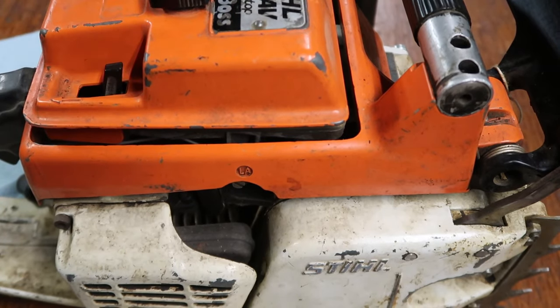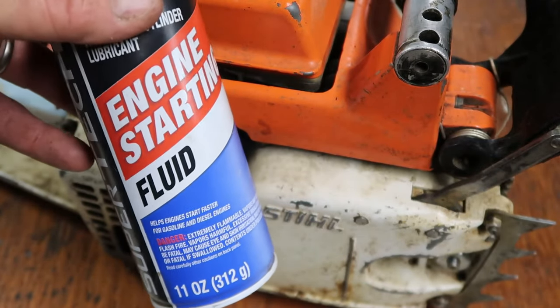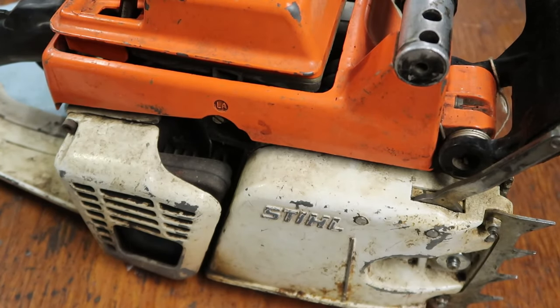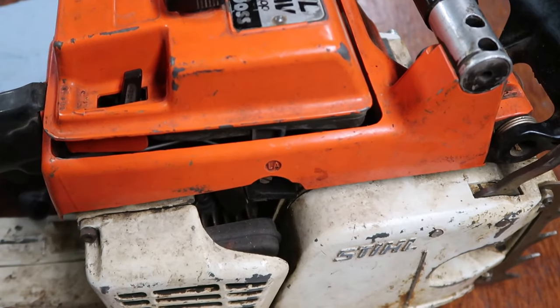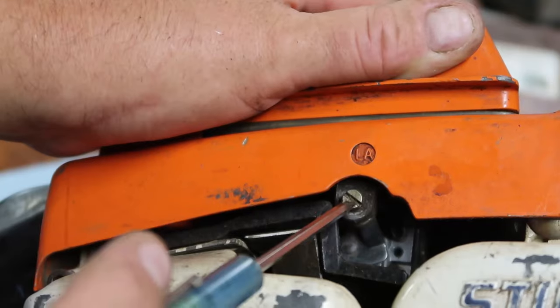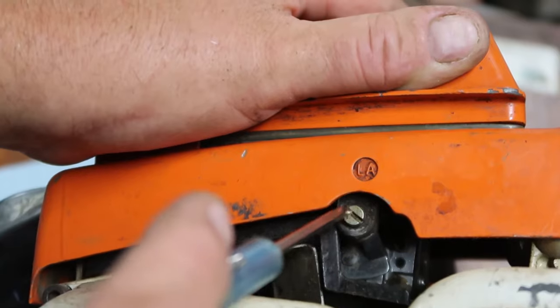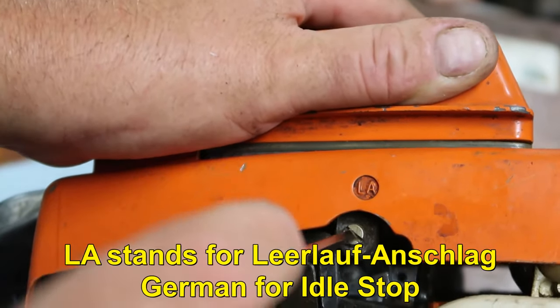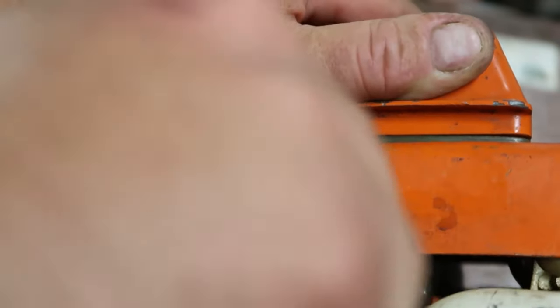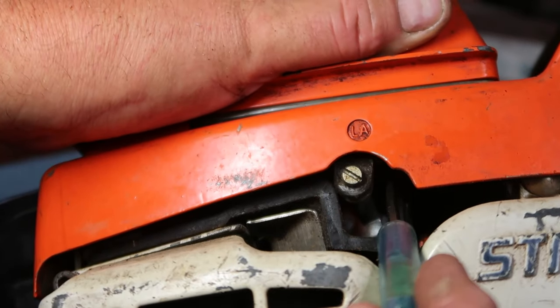Outside, I'll give it a few pulls to see if it starts. If not, I'll use this engine starting fluid — again, auto parts store or Walmart, a couple of bucks a can — just spray a little bit into the carburetor to encourage it to start and get the fuel flowing. I also take a small screwdriver with me. There's an idle speed adjustment screw — on Stihl they mark it 'LA.' Screw it in and the idle goes faster; screw it out and it goes slower.